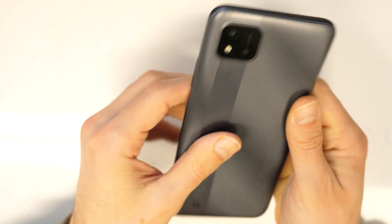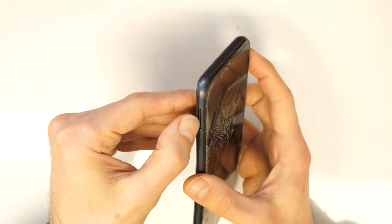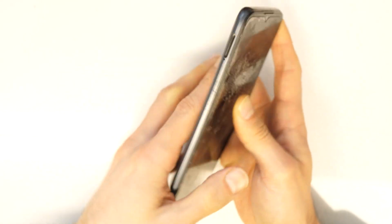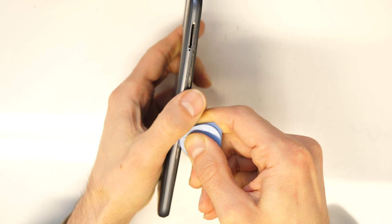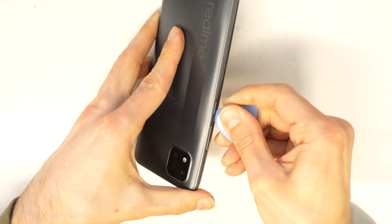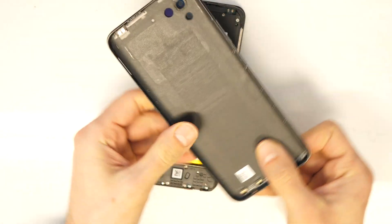The back cover seems to be made all around, so there is no back glass which needs to be removed. We just need to remove the whole plastic cover here. The best is you start somewhere near where the SIM card tray is, make a gap with your fingernail, and then use a plastic tool like this and just go around and open it. Then you just remove the back cover — very easy.